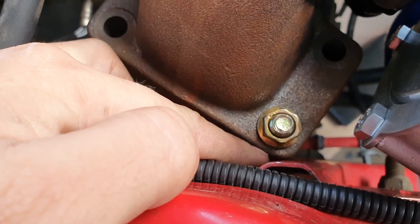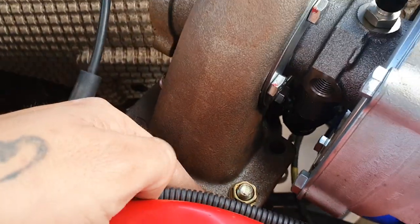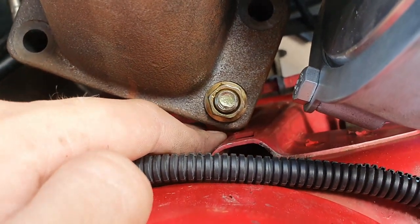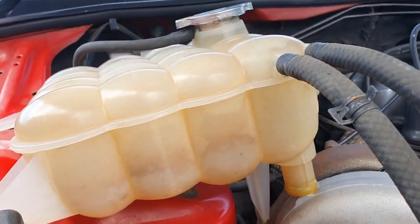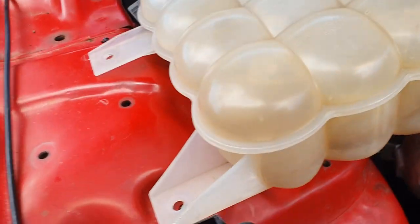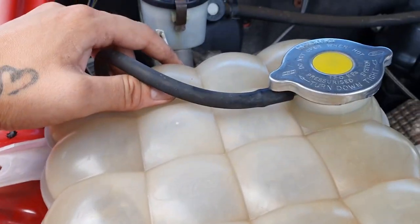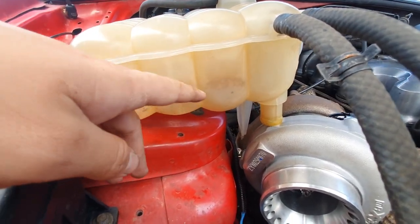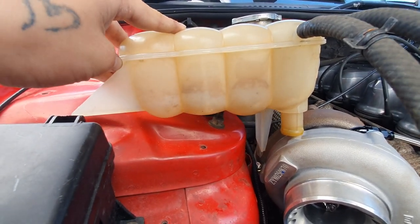Running the loom down to the steering rack. The turbo rear housing flange is hitting on the body, so I'm going to mark around it and grind that part of the rear housing flange away for clearance, then put heat tape along there to stop vibration and heat. The coolant reservoir doesn't fit with the turbo setup — I could make a metal one, but on the povo budget I was thinking of cutting the plastic one up, melting it with a soldering iron, reshaping it with sealant and two-part putty.